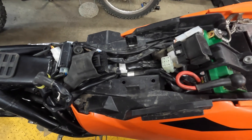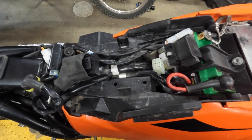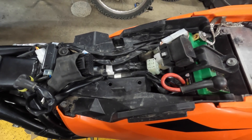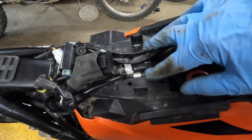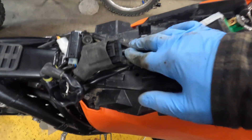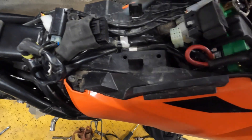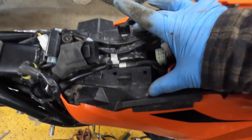When I'm doing this kind of work I generally like to pull the ECU — when you're disconnecting and connecting electrical devices, it's nice to not have to worry about static electricity doing something nasty to that unit. Also pay attention when you're putting the unit back in that your cables are routed nicely so that they're not getting pinched. You want to make sure there are no cables or anything interfering with the seat base that sits in here.